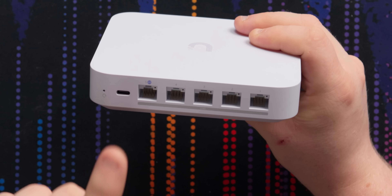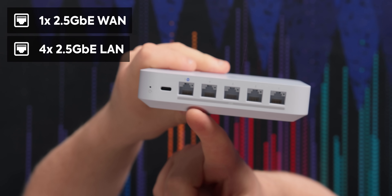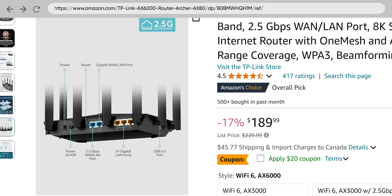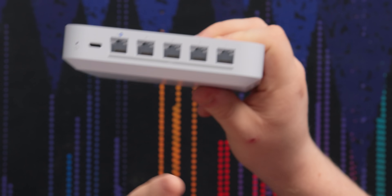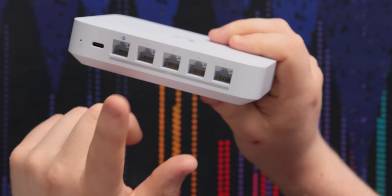There's a little reset button, USB-C power in, and then the star of the show: a 2.5 gig WAN port and four 2.5 gig LAN ports. I can't tell you how many times you get a 1.5 or 2 gig internet connection and the WiFi router has a 2.5 gig in but only 1 gig out — you're not even taking advantage of it. In this setup you've got 2.5 gig on all ports, and you can configure one of the LAN ones to also be a second WAN port, which is a nice touch.